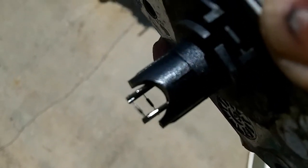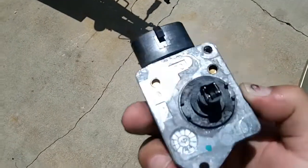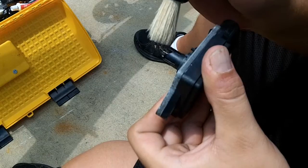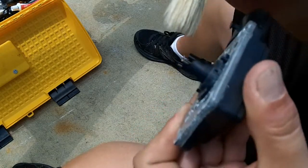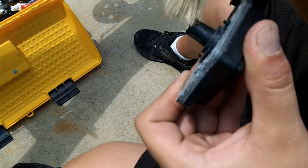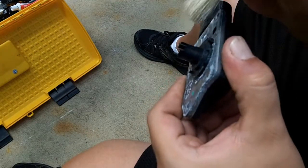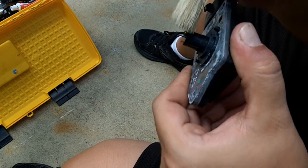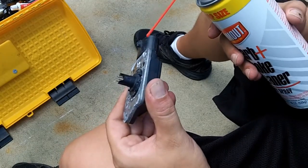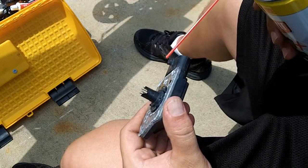So we're going to have to be extremely delicate when we clean this. You break those wires and that's it — this is a very expensive part, so be very, very delicate with this. Treat that like a baby. You don't want to press on it; you just want to keep brushing. Normally I would say don't touch the wire at all — just use your can of throttle body or MAF cleaner — but this is so gunked up that MAF and throttle body cleaner won't do the job.